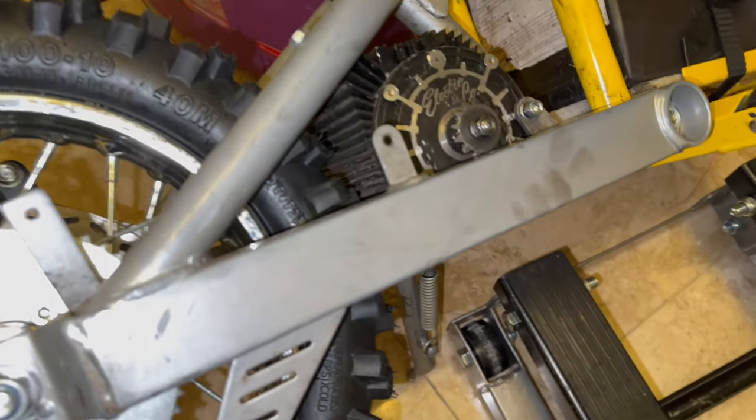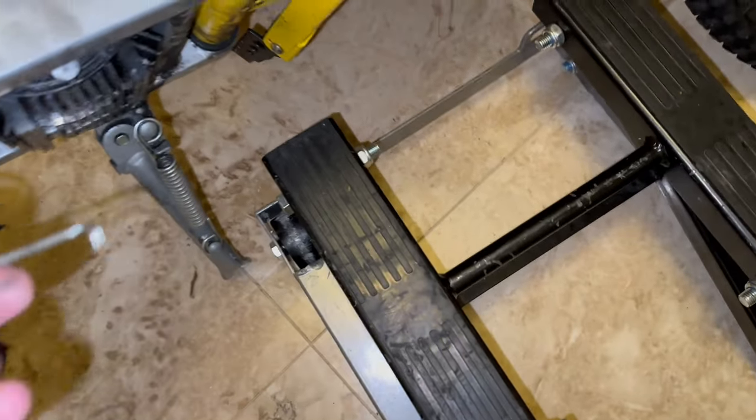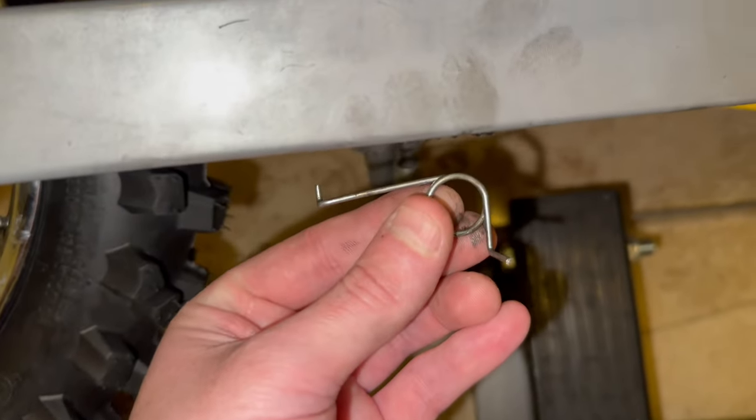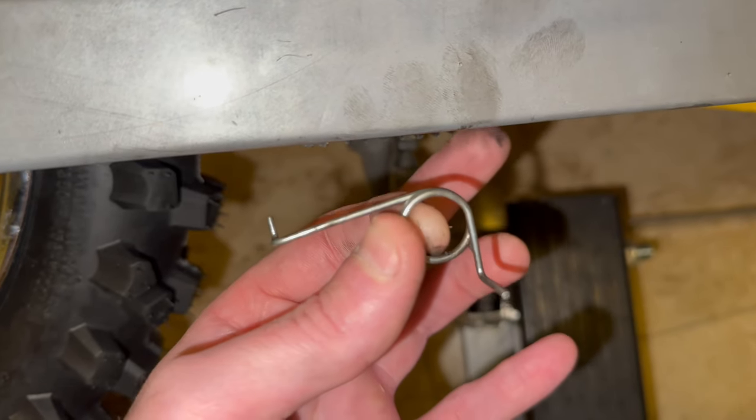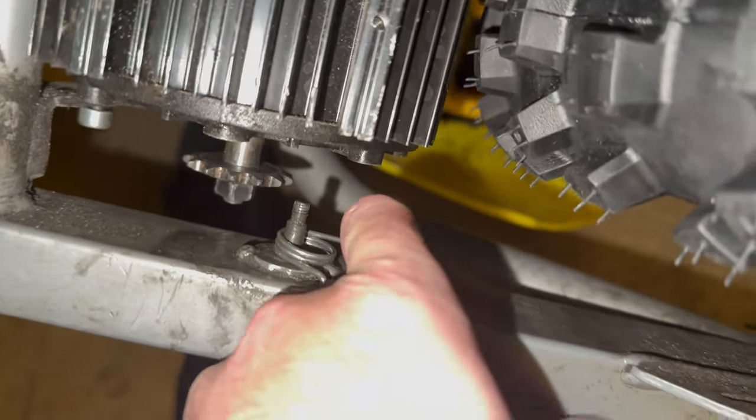Maybe I'm just dumb, maybe other people have made the same mistake, but let me tell you — before you go and put your spring on, your spring has to hold on somewhere. It's going to hold on your tensioner around the stud, okay, around that stud right there. Once it's around the stud, there's a little hole here almost exactly the diameter of this — see that hole? That's where it's gonna go. If you skip that, the spring will get screwed.